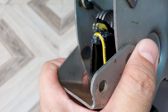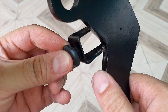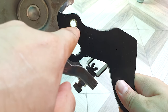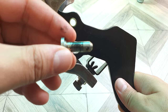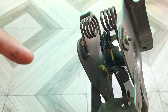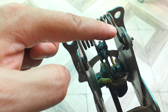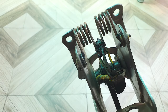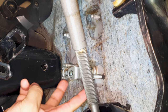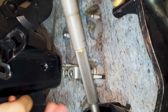As far as the stopper goes, I got the base of a clip and I'm just going to use that temporarily. I will put some grease over here and on this metal pin which slides into this. I'll grease this up a bit more. Just make sure that the spring is resting properly. Now time to reinstall this. When installing the pedal back, make sure you do not push on these two here - this is part of the clutch master cylinder and you'll push it out.